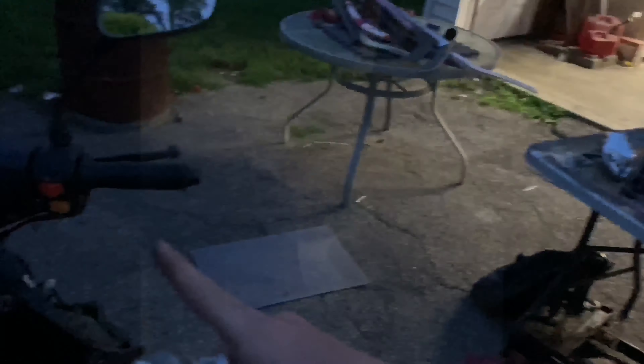So we're running a DC setup to an LED bar in the front. What we're doing here is cutting a hole directly in this headlight that goes into the housing, because I'm not going to use this anymore — this is going to be junk. We are connecting a current straight from the battery to a fuse to a switch to this headlight. It's a 12-volt battery. The light draws 1.2 amps, so not many, but I got a 10-amp fuse here.